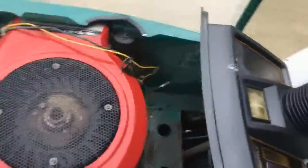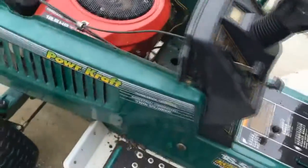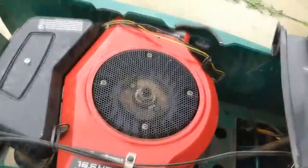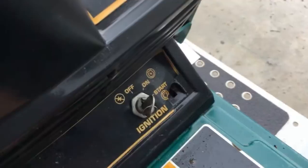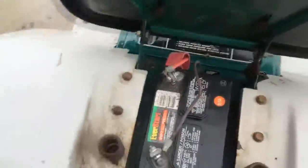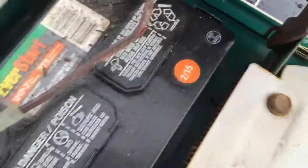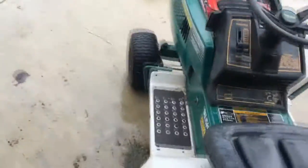So anyways, this is it. The gas tank sits right in here — I've got the gas tank sitting over there on top of the toolbox. The motor is not seized or anything. In fact, I actually had it running earlier. The guy told me that all he thinks this thing needs is a new starter and definitely two new rear tires. But as far as the starter is concerned, I don't think there's actually an issue with the starter. I think it was more of just a battery issue. When I got there and picked this thing up, he had the key in the on position. So he said he was having issues starting it, and that was probably why. Because this is a newer battery — almost a year old — shouldn't really have any issues with it. But nonetheless, it does have that starting issue.